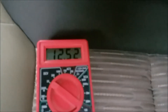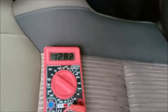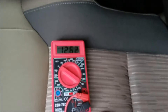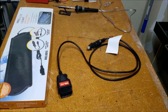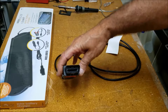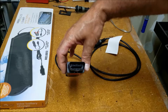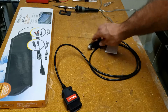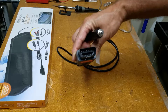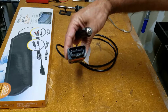This has the added benefit of telling you that there's power — you can tell by the voltmeter that it's getting something. It's jumping around because the door is open, turning on dome lights and things like that. So with the door closed and the truck locked, it should be just fine. I already did tests that confirmed that the voltage coming through the port matched the voltage from the battery. I went back and did it with the doors locked and the alarm set, and the voltage stabilized. So I have no doubt that the voltage jumping around has something to do with the truck preparing to be started — like the fuel pump and things like that boosting.